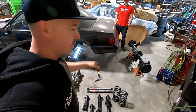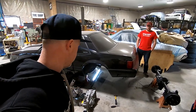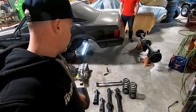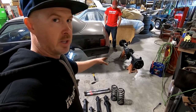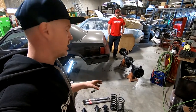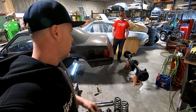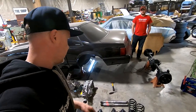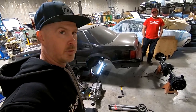Now it is time to put the rear end back in the car. Got Braden here today messing around with me — always helps to have an extra set of hands when you're putting your diff in. Got a nice set of springs, KYB shocks for the rear. Went ahead and cleaned up and painted the control arm setup. The diff is all painted, changed the fluid, put in our friction modifier. Did validate on the ring gear — it was stamped 373 — so we were right in our analysis when we spun the pinion and checked against the drums turning. Our math was correct, which is good.